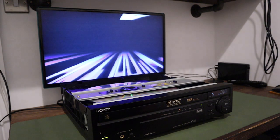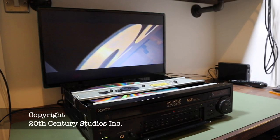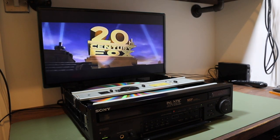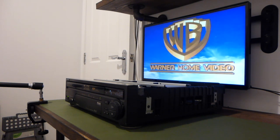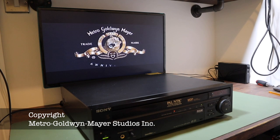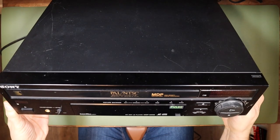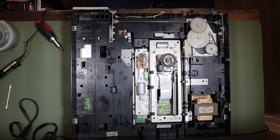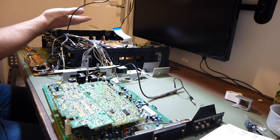It works! How fantastic. Heed the FBI warning — I can unfortunately only show you snippets of what this player can do. Before we finish, one thing I should add is that I don't think the printed circuit board problems were the reasons for the initial difficulties. I think the positioning of the cogs and the cleanliness of the contact switches — showing whether the tray and chucker are in position — were the real culprits as to why it wasn't working in the first instance. But clearly the damage to the printed circuit board assembly had to be repaired and was probably necessary to get a working machine.